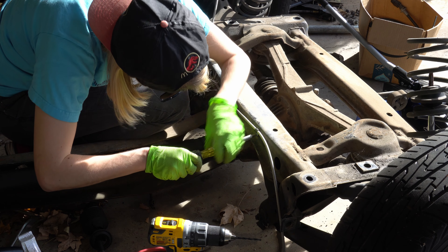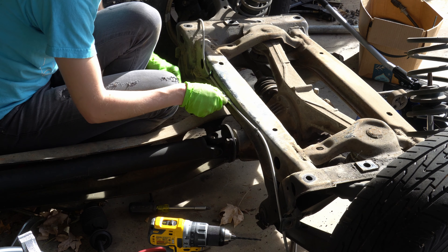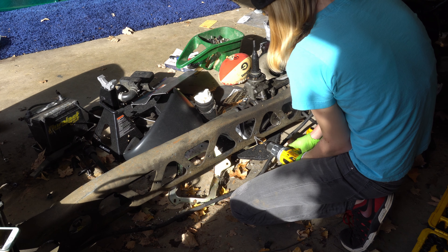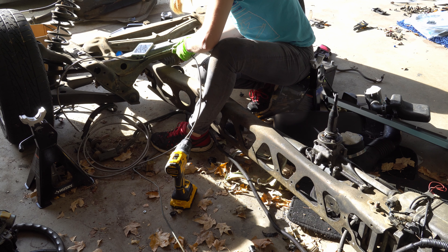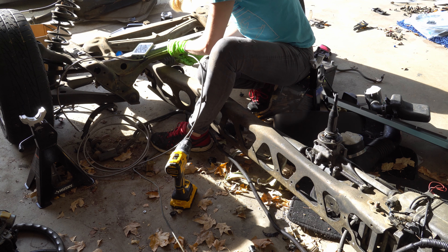I'll probably want to use some thread lock on this, but right now I'm just trying to get everything mocked up. Now that I have these in place, I'm going to start drilling holes in the I-beam that's going to allow space for both the loom itself and that rear brake line. Again, if you have an NB Miata donor, then you probably can run this brake line along the inside of your chassis where my fuel return line ended up. But since I already have to drill in this for the loom, it made sense to just run them both.